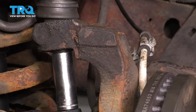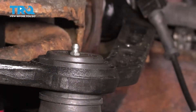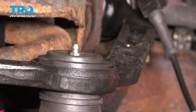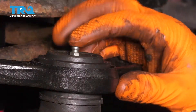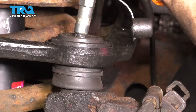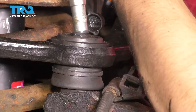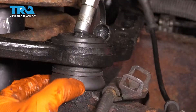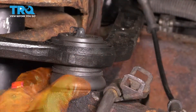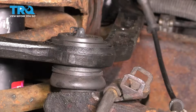Torque this to 37 foot-pounds. At the top of the ball joint here there's a grease fitting so you can grease the ball joint when you need to. Use a 7 millimeter wrench or socket to snug this down — don't over tighten it because it'll break very easily. Now let's get the grease gun and grease this up. Lock your grease gun on and add grease until you can see the boot start to expand. The boot is starting to expand, so give it a couple more pumps. If you put too much it's just going to start bleeding out, so it's really impossible to put too much.